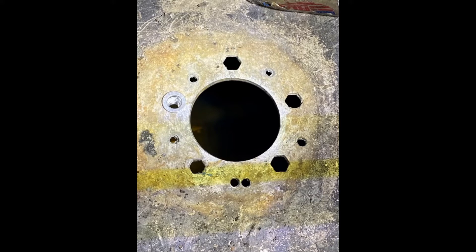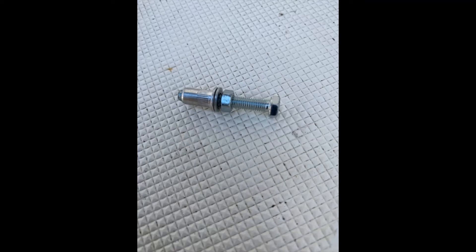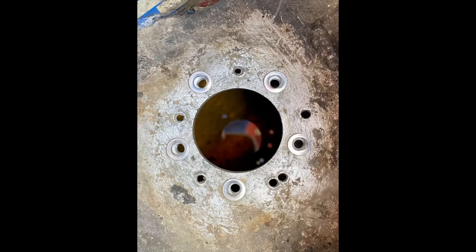What I did on the top left here was find a suitable crushed nut, or nut plate — these are available on Amazon. I bought a whole kit with a couple different sizes, and instead of buying the $50 tool to crush these, because they're aluminum it doesn't take a lot to get them to lock down. I went and bought a bolt and a nut — just push it down and in, run the nut down flat. I have a little washer in there that holds separation between the nut plate and the nut so the nut won't tear up the face of the nut plate. You just turn the nut plate until it snugs up, put a wrench on top, twist the nut until the bottom pulls up, and voila — you have five nut plates.